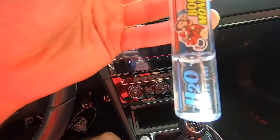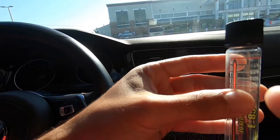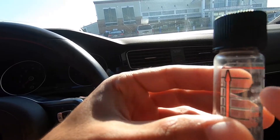As you can see, it has a blue line. It says fill up to that blue line with water, and then from that blue line all the way to the red line with E85. Give it a shake and then it's going to give you the actual percentage at that station. So let's go ahead and test this.